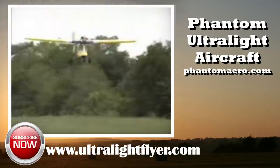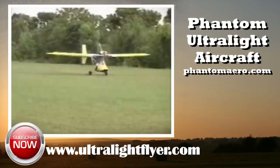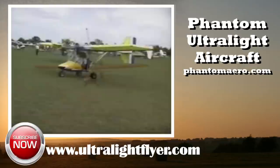The Phantom is a wire-braced, high-wing, tricycle gear ultralight aircraft in a tractor configuration, with a pilot pod and a steerable nosewheel. Controls are standard stick and rudder with full-span ailerons. The Phantom has a left-hand throttle and right-hand joystick. Cruise speed on the Phantom ultralight is between 55 and 60 miles per hour. Climb comes in at around 700 feet per minute. Stall speed comes in at approximately 25 miles per hour.